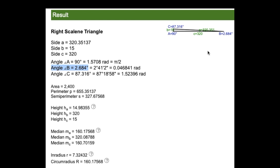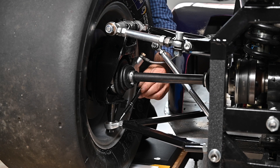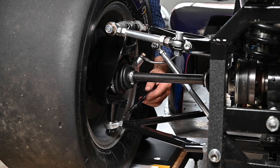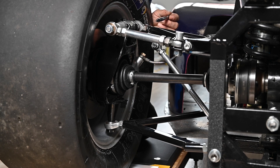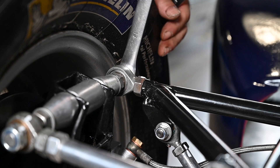There's always a bit of offset or tolerance because we didn't measure with 100% accuracy, but you can see you get very close with this kind of tool. I have two adjustments on this car — one on the top and one on the bottom. On the top, if I extend it I get less negative camber or more positive; if I bring it toward the center I get more negative camber. On the bottom it's the opposite. I currently have 2.25 degrees, so I'll extend the top one a little bit — I'll give it one full turn and see what happens.